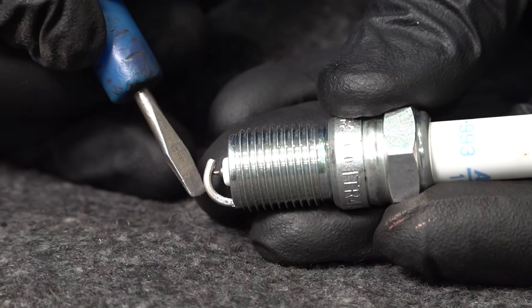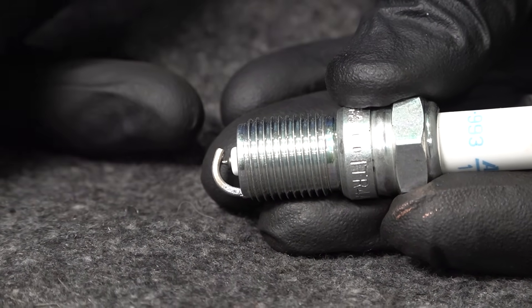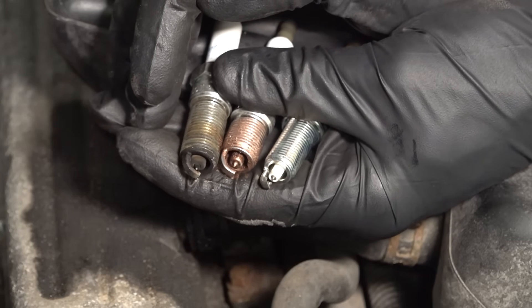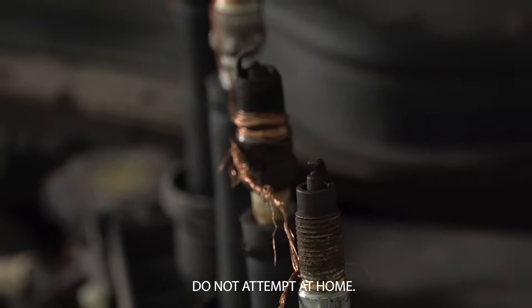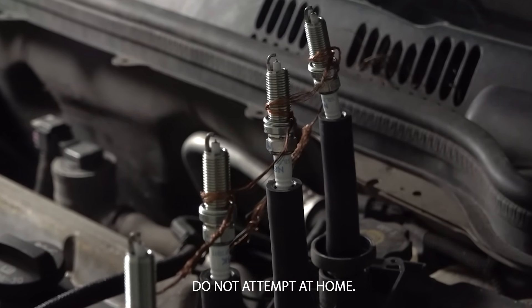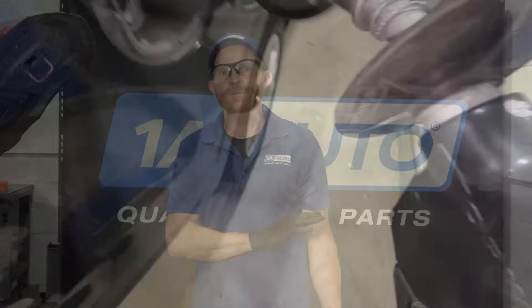You also need to look at the tips — where the electrode is going to be very important. They can be made out of several different things: sometimes copper, other times platinum, double platinum, or even iridium. All these have different heat points and they're also going to create different temperature sparks. So you don't want to mix those up — you could potentially change the timing of your engine or cause some sort of runnability issue. Make sure you get the proper electrode type, and replace all of your spark plugs at the same time with the same exact type for maximum fuel efficiency.